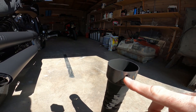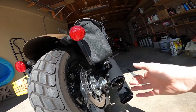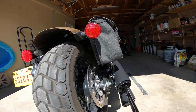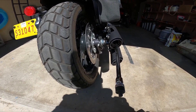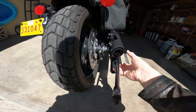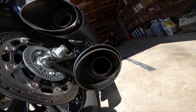People were asking me how I got the baffle all the way back in there. I just took my breaker bar, put it all the way to the back — it stops because there's a flat piece back there — and then I hit it with a mallet until I reached the point where the screw hole lines up. The screw goes in right here. You just loosen these, pull it forward a little bit, and it gives you access to the screw. But as you can see, I didn't line it up right.